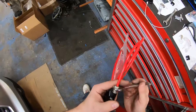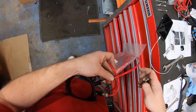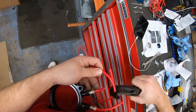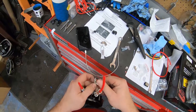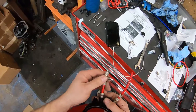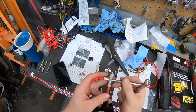With one piece of hose in each nozzle, I'm bending the hose to figure out how close I can get the T-fitting. I had to decide: do I want both hoses going into the branches with the feed coming into the run, or feed coming into one branch with the run going to the other nozzle? I elected to go with the latter — it looked cleaner. Hoses cut to length, nuts slid over each piece, T-fitting installed into the nozzle plate, both sides connected with proper bend radius so the injection hose isn't kinked. The plate is ready to install onto the truck.